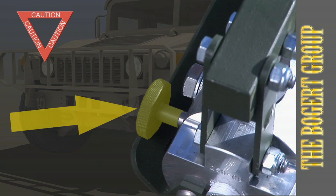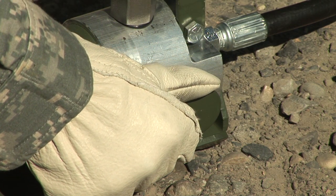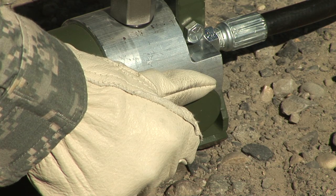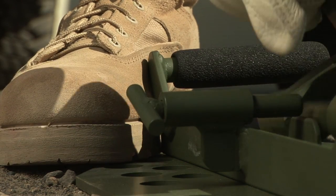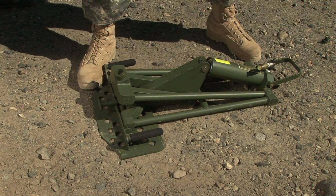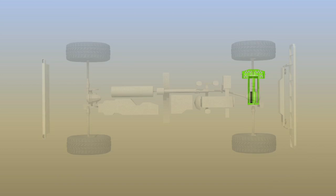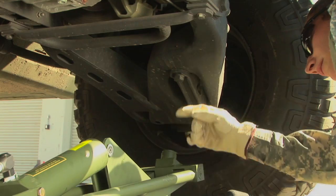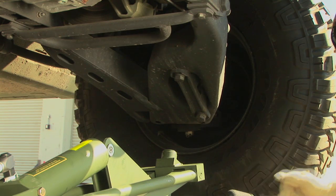The release valve on the hydraulic pump controls the release of the hydraulic fluid, causing the jack to lower. Opening the valve too quickly will cause the vehicle to suddenly drop. To lower jack, slowly turn the release valve on the hydraulic pump counterclockwise not more than one full turn to release any pressure on the pump. Then press down on the saddle of the jack to lower it to the fully retracted position. Seat the nose of the jack into the base plate by pulling back on the base plate plunger, then setting the front of the jack into the angle iron slot. Release the plunger. The jack must be in line, parallel with the axle of the vehicle. Position the saddle of the jack under the recommended lifting point, which is at the uppermost shock mounting bolt on the underside of the lower control arm.